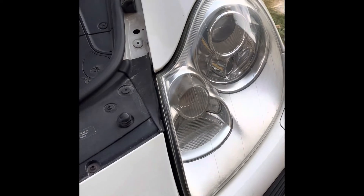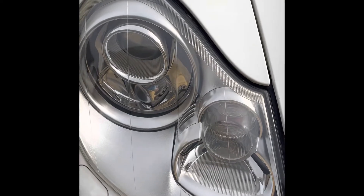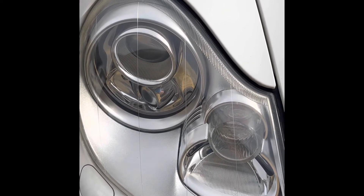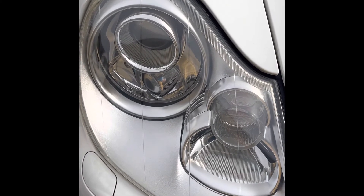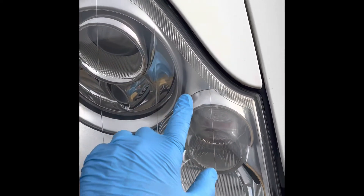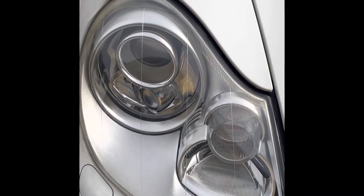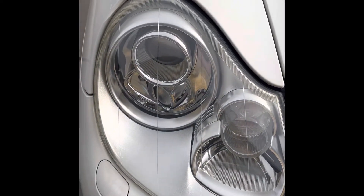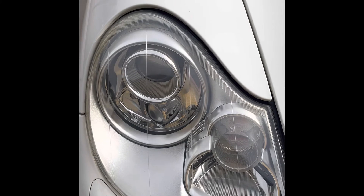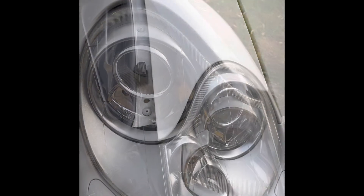This is the passenger side - I went with 1500, 2000, 3000, 5000, then compound, then polish, then wax. It looks good. There's a mark there where the pliability issue happened again. I'm gonna see what happens - if it starts fogging again, which I'm assuming it will since the clear is pretty much gone, I'll use the cleaner and the gray scratch pad, then paint it again. Time will tell. Please subscribe.